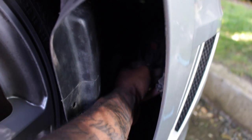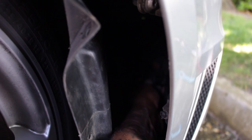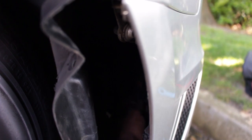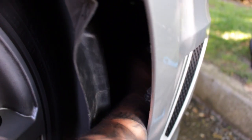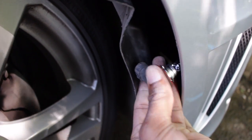All you need to do is press — there's a little clip in here, you will not be able to see it because it's very very dark, but there's a clip. You push down on the clip and you've got to release the plug before you try twisting out the bulb, because there's a little blocker in here that is actually stopping you from twisting the bulb out with the plug still on. Twist it anti-clockwise and then out it comes — simple as pie.